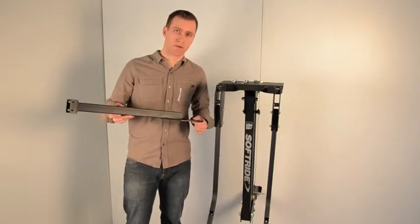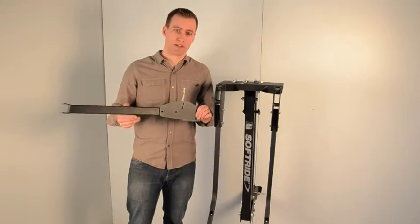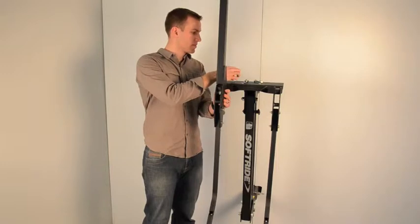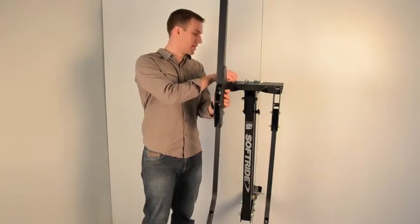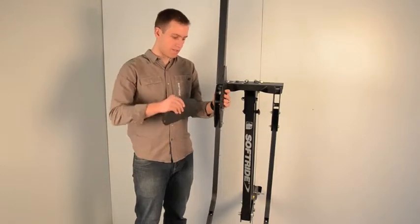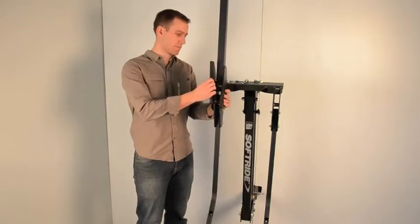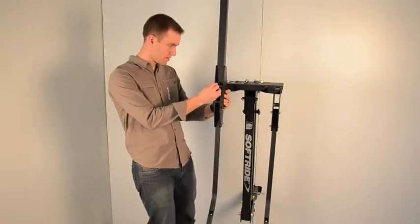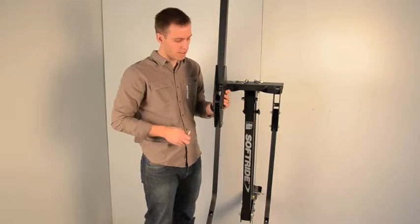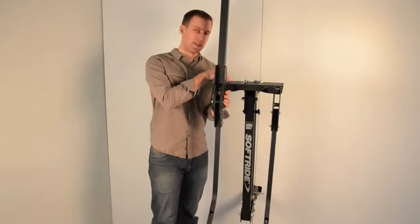In all honesty, it's a little bit tricky to figure out which way these face, so refer to the drawings. The flat edge of this plate is going to be facing away from the vehicle. It's certainly going to be easier if you have all your plates and pieces lined up ready to go beforehand, or if you have a friend with a second set of hands. We're going to put a bolt through the lower section first — once it's in, things will start to stabilize. Be careful because this thing can still pivot down and get you in the head if you're not careful.